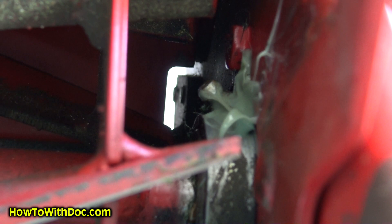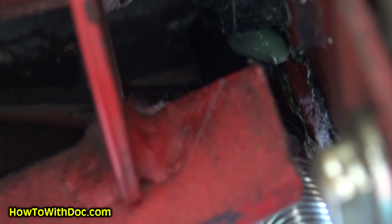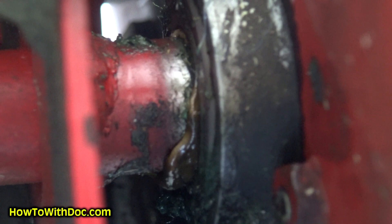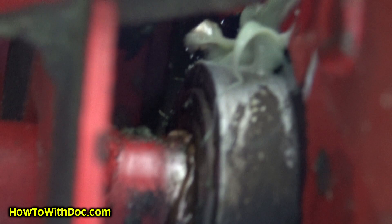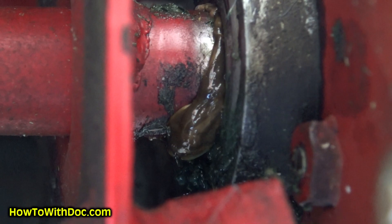You understand my frustration. The top one — every time I squeezed the handle, grease just shoots out around the fitting. I can't get a good seal in there. However, there's one on the bottom that I finally was able to connect to. Watch the axle — you'll see grease start to shoot out. That's what I want right there. When I see grease shooting out of that joint, I know it's filling up with grease. I watch the nipple. That's the first time I've been able to get grease in there. Unreal. And that's the only tool that has allowed me to get in there and do that.